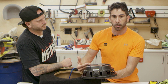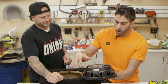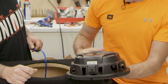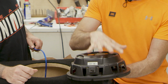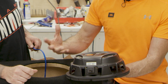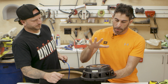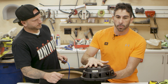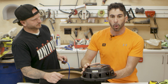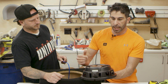Now, naturally, you're going to say, well, Jeremy, Reme, you like more bass. You want to put 2 woofers in your car, so I want to run 2 10s. I got you covered. Flip that switch. We're at 4 ohm now on each individual woofer. We series it, and then it's paralleled going into the monoblock amp, so it will run at a 2 ohm load. So real simple. You can basically buy one woofer from JBL and run the Club Series in your car. Next week, when you get a couple extra bucks, you want to add more bump, you can add the woofer in, pull it out, flip that switch, change the impedance, and again, you are good to go.